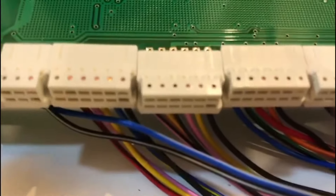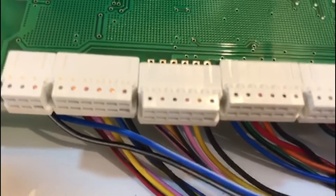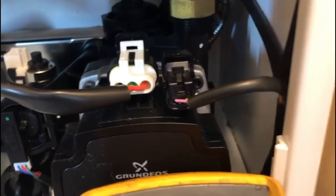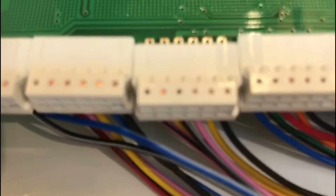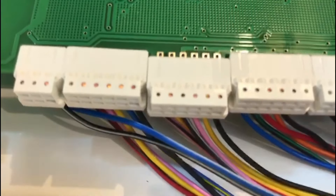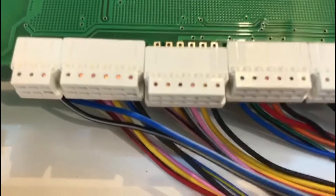The first test: disconnect the power and pull that lead off. Find the connection on the circuit board — you'll see two sets of PWM connections: black, pink, yellow for the fan and black, pink, yellow for the pump. We have exactly the same principle on the pump: a 240-volt supply and a PWM signal. One connection is the pump, the other is the fan. The left-hand connection is the fan; the right-hand connection is the pump.